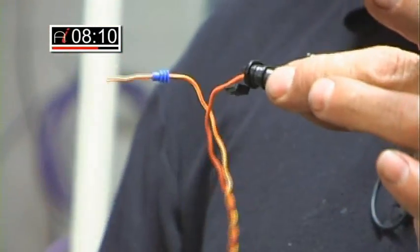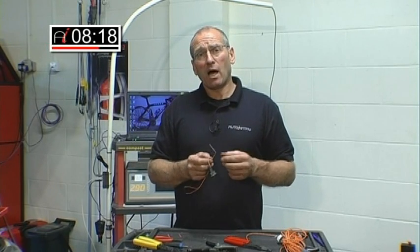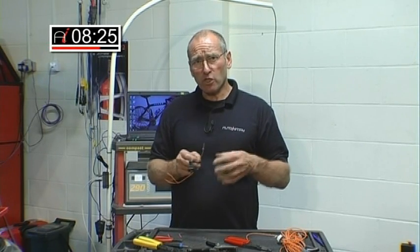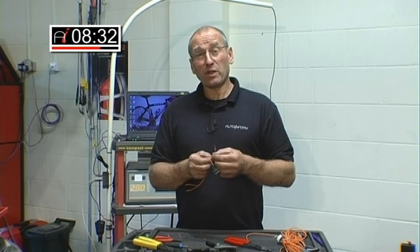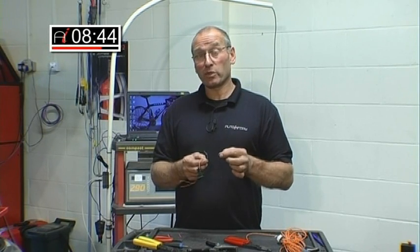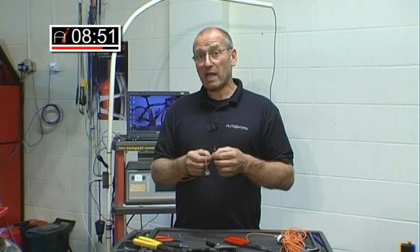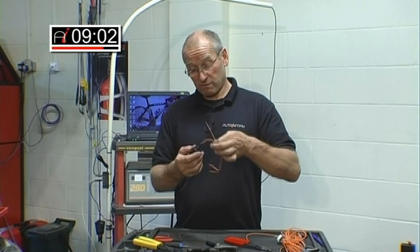You can see it's reattached completely without any damage. This is a very important issue, because we're actually finding now that a lot of wiring problems are problems with what we call sensor plausibility — where quite often, when you actually make an ohmic measurement with a multimeter, you often find the resistance through the cabling is quite good. But nonetheless, you still get a problem with the actual quality and the integrity of the signal, leading to many problems. Correct cable connectivity is a real issue, particularly with CAN networks and particularly with sensor circuits. Many manufacturers are now producing repair kits for terminating new sockets and components, and it's important that the termination quality be carried through right the way through the loom.